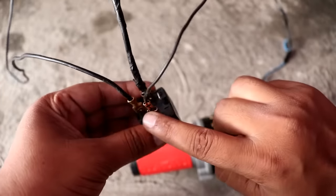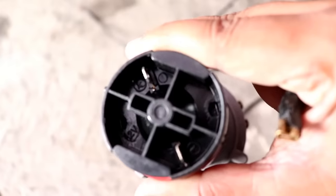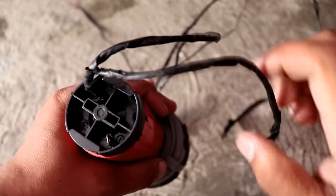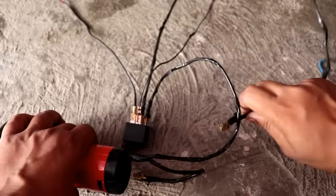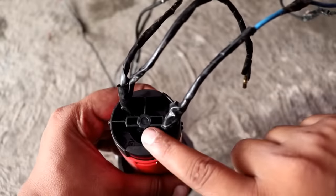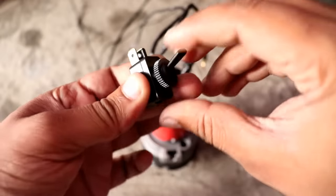With this next terminal, put another connection — it goes into your main controller. You can see the main controller positive here, so connect it there. Now the positive connection is done. Connect the negative wire to the vehicle body to complete the ground. Now when I press the horn, you can see the main controller is working — the connection is completed.